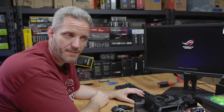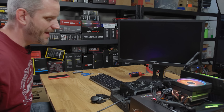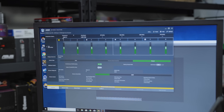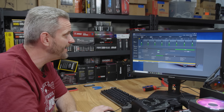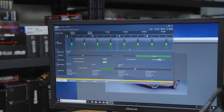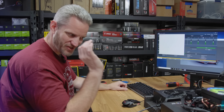Just go straight to 1.45 volts and then pull it back — let's just do it. I think it's just going to go straight to like the 80s and then start to throttle. We are already at 75, 76, 77 — 4.2 gigahertz all the way across the board, 90.75°C. It still says 4.2 though, so I don't think it has throttled yet. Opening up task manager was just enough to cause it.